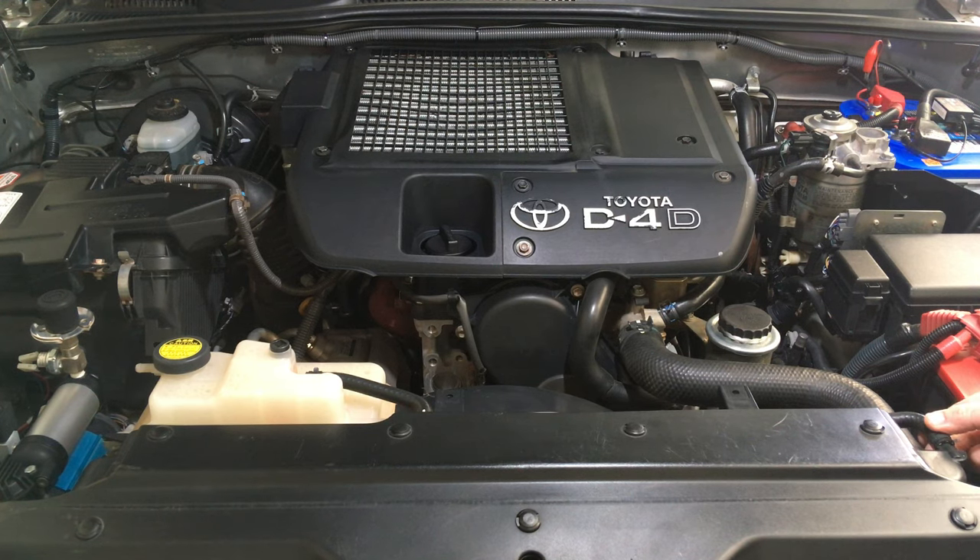I'm going to give you another caution: do not lean on this radiator. It's 12 years old. People say they're really brittle and break off easily. I haven't ever been able to break one of these, except when someone helping me did lean on it and did break it. We were able to do a fix — fold the little tabs at the side back, slip the hose on a bit further, glued the piece back on with two-part rapid fix, put the clamp on — it was all good.